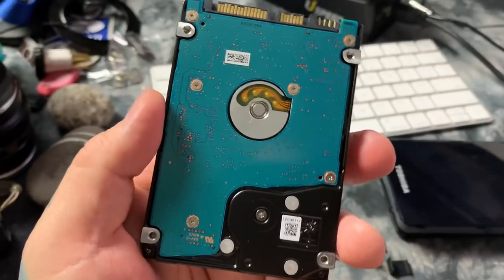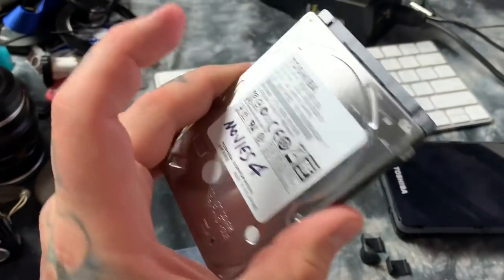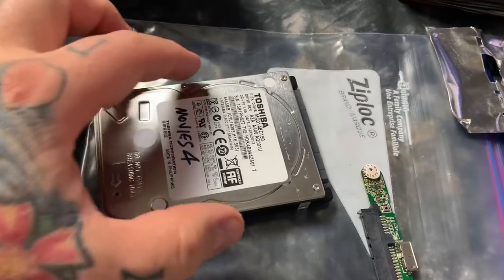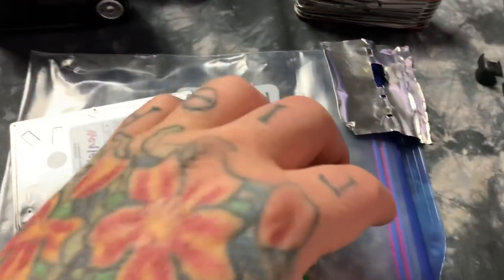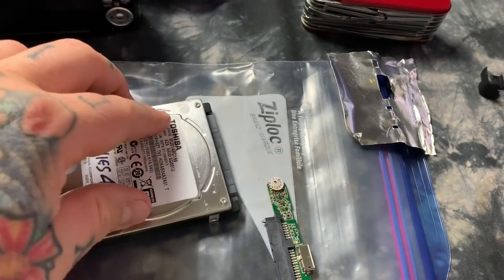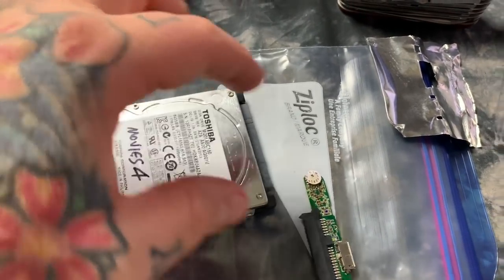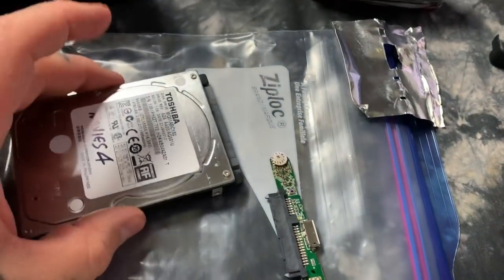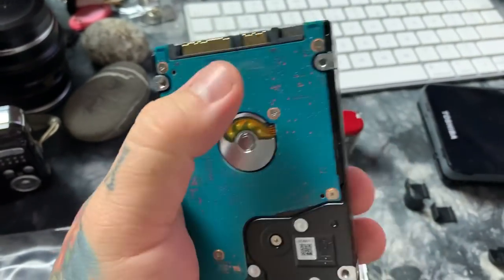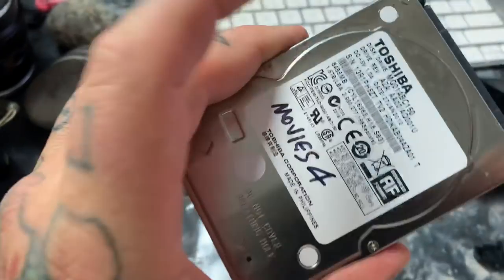One of the secrets when you send in a defective hard drive for data recovery is that they'll take an identical hard drive, unscrew it, and I've done this many times before. It's a gentle process. First, you take the platters out of the completely new drive, and then you unscrew the central axle and take out the platter assembly and drop it into the new hard drive. Because on a naked hard drive, 99.9% of failures are either main board failure, which is the circuit board right here, main motor failure, or head crash.